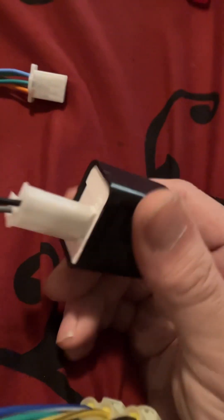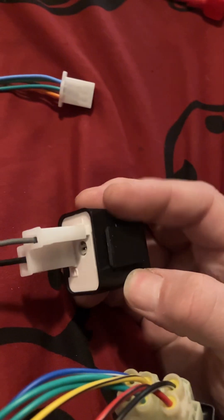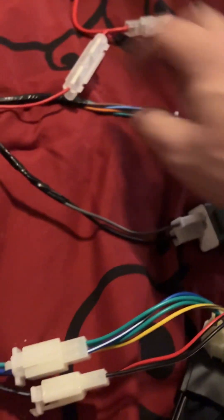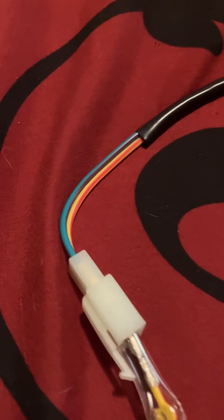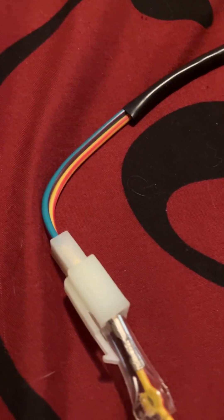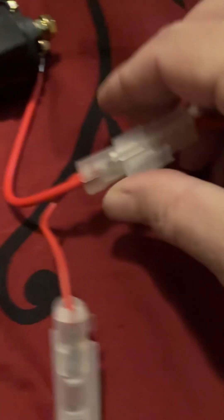Going around here, you have two wires coming up and my LED relay is already here for the flashers. You've got your hot wire coming back this way, and your green and yellow which go back to your starter solenoid — I just haven't had one laying around so we'll run what we've got. The color codes match — yellow, red, and green. There's also a connector I swapped from another harness that lets me unplug from the battery, so I can quick-disconnect the battery if needed.